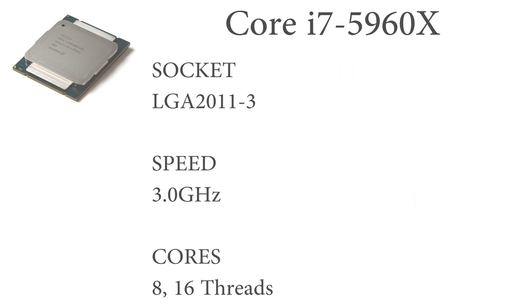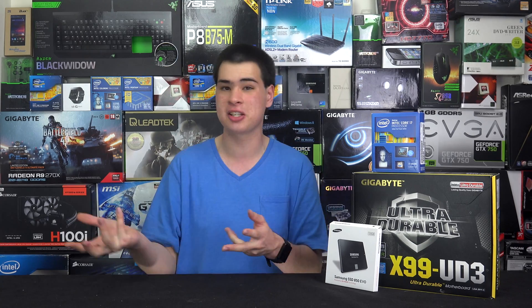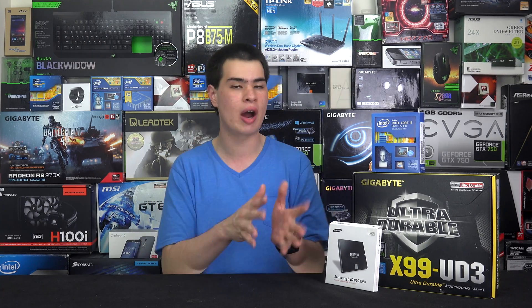Each system we're targeting about $1500, with at least a quad core, 16GB of RAM, some sort of video card for gaming or multimedia, and plenty of storage. The CPU we picked was the 5960X — an 8-core, 16-threaded CPU that can definitely be overclocked. The main reason we went with the 5960X over a Xeon part was mainly due to cost, and also because we needed the PCI Express lanes to run all the video cards in this system. We're going to split our 16 threads into 4 cores each — theoretically 2 physical cores with 2 hyper-threaded ones per user.